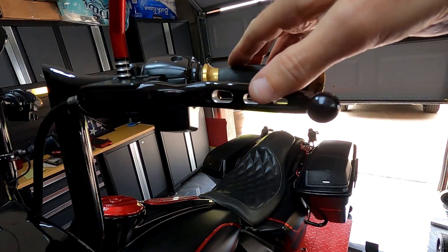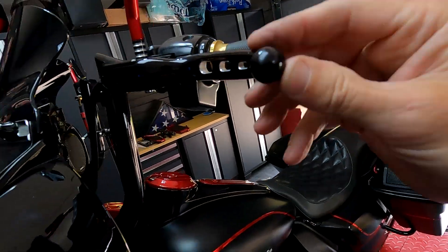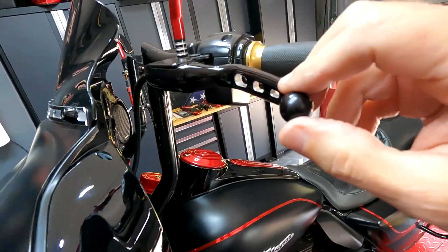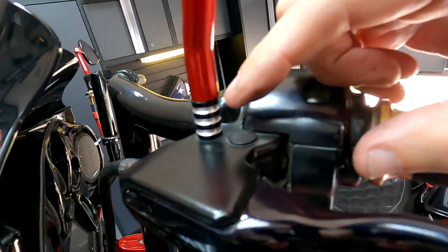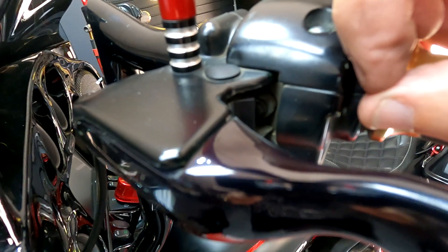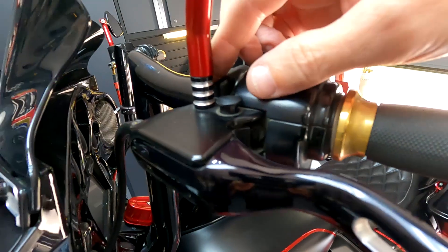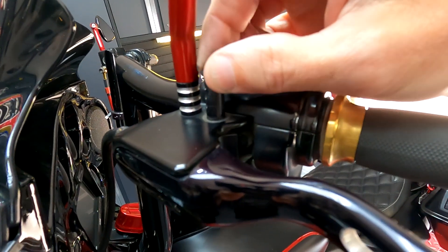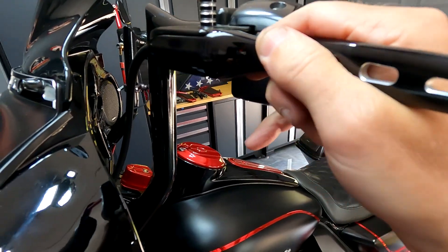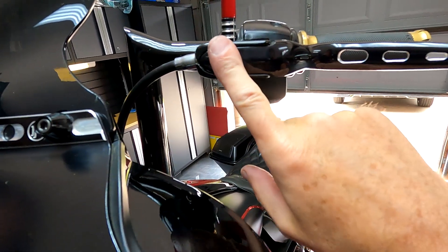These are the levers I have on the bike now — they came with it when I bought it. I like the width and machining, but they're both kind of bent; this one's got a mark in it and the other was scuffed up. To get these off, there's a pin on the bottom side with a circlip — just take off that circlip and slide the pin out. I've got a cable clutch, so I'm going to have to loosen up the cable adjuster to get this off, since the cable is under pressure.